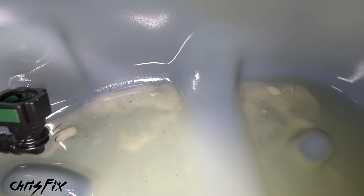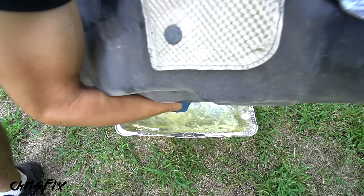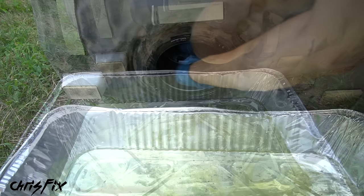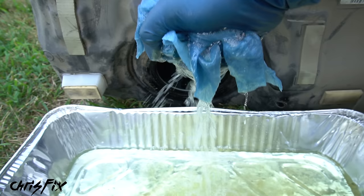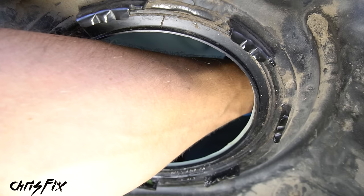You can see a bunch of the sugar made its way into the tank, so let's clean this out. First, drain the gas from the tank into a catch can — get as much out as you can. It won't be perfectly dry but the more you get out the better. Then use towels to soak up the remaining fuel and wring it out into the catch can. With all the fuel completely removed the tank is bone dry. There's also some sugar left, and it would take forever to try to get all the granules out, so let's also disconnect and remove this fuel line from the tank.